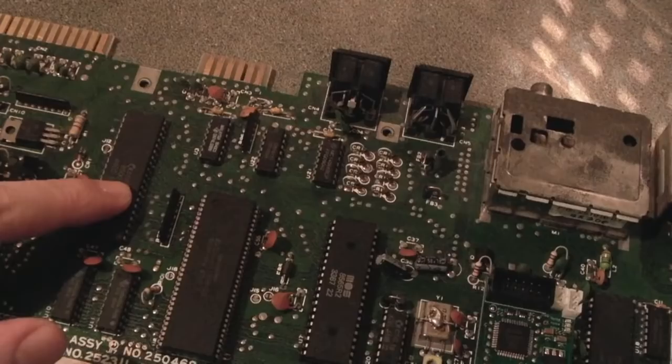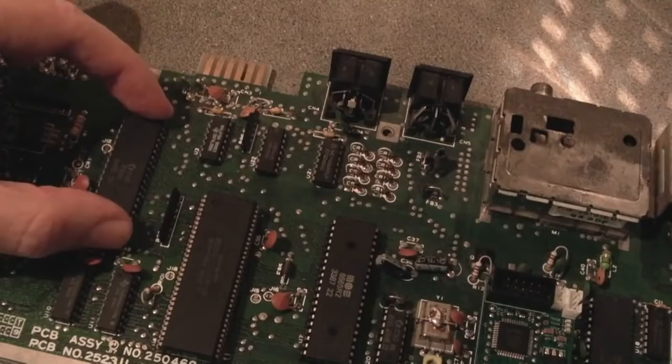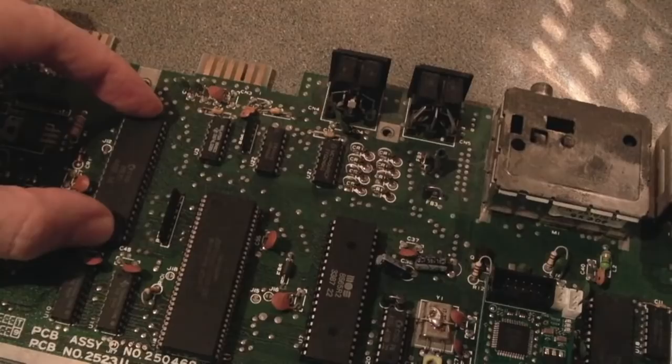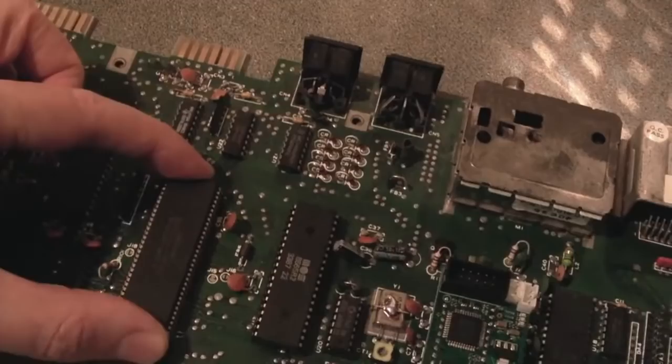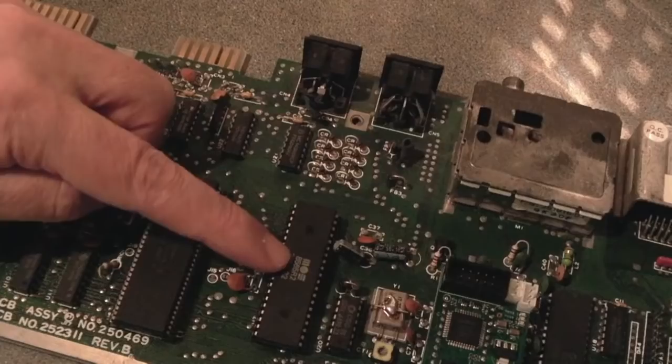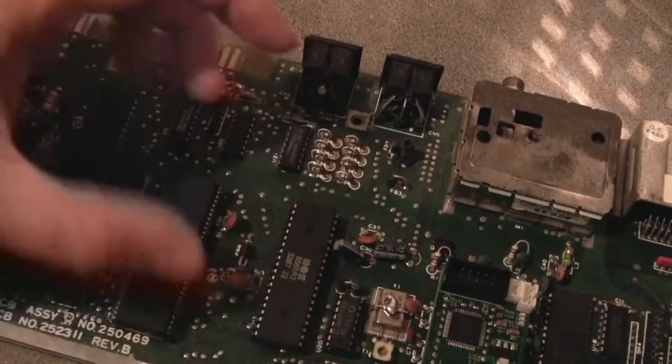But you could fit a 6510 there, or backfit that onto one of the older Breadbin boards. Your PLA is obviously completely different. This integrates some of the 74 series stuff that would normally be on a Breadbin. It's merged in with that, so you can't easily swap the PLAs and things around. And the VIC chip on the 64C is an 8565R2, I think.